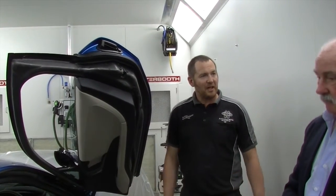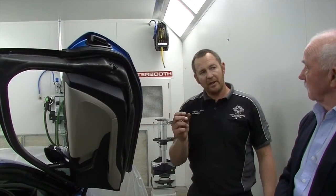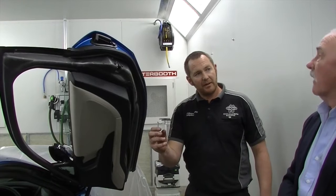When we actually mill it, you have to be careful that you don't go through the glue into the next panel. If you go through the glue into the next panel, then you render the next panel damaged. So when you talk about milling, you mean like a router? It's got a diamond-tip stone — it just mills, like a grinding stone. It's a sophisticated method of grinding, basically.